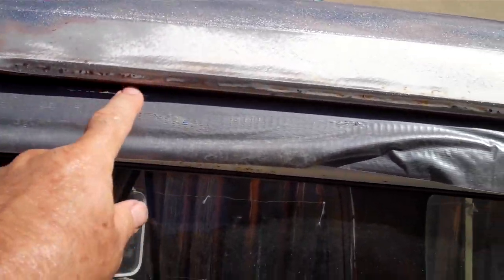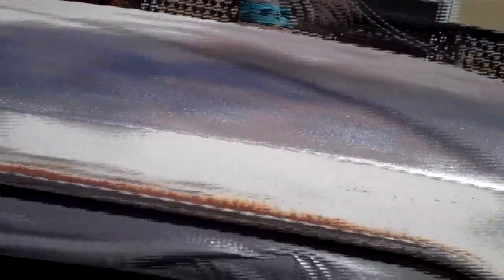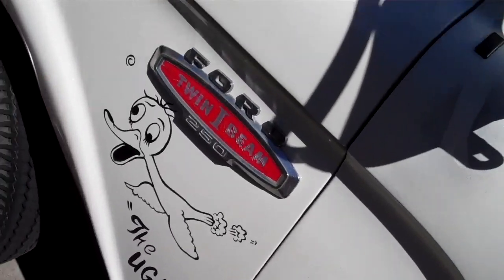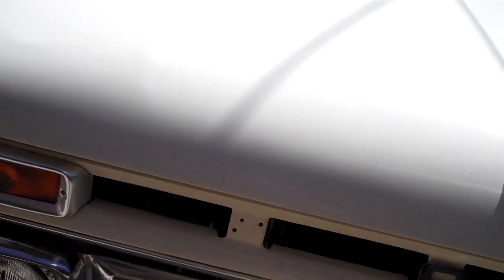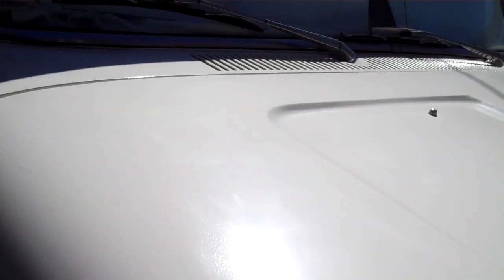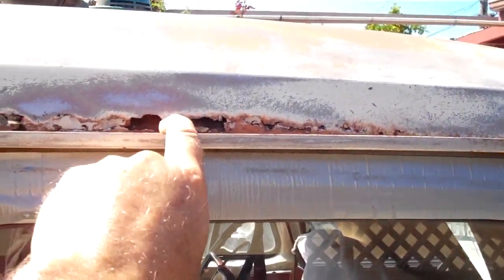I've got some damage right in here — you can see where the drip rail is rusted through. Come over here, you can see the shadow cast by the drip rail that's rusted through a little bit. I'm gonna have to scrape all that out. I'm just protecting the paint on the door right now. I painted that last summer, trying to get this done before school starts again. I showed the guy this and the drip rail, and he wanted $1,600 to fix it — but can you get a new cab top? I said no.